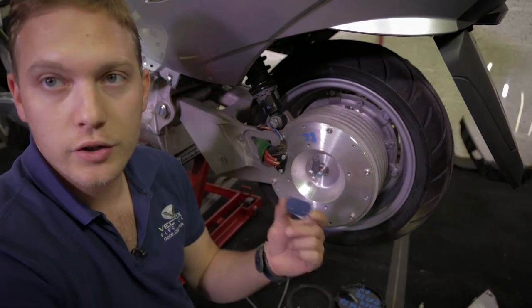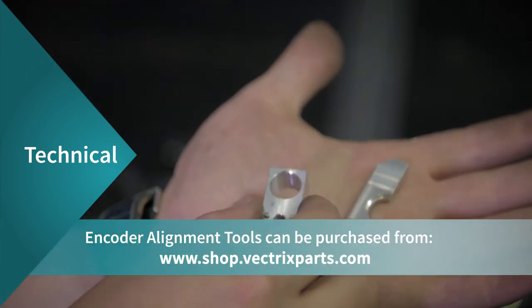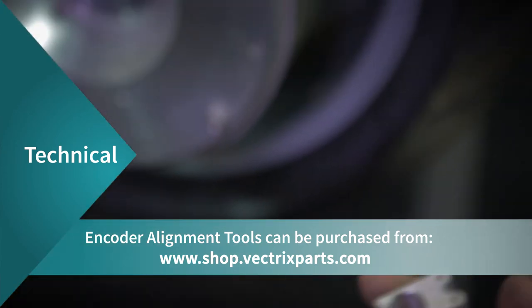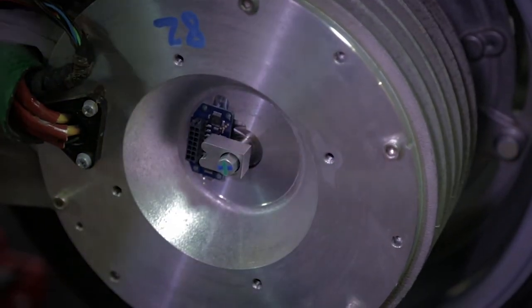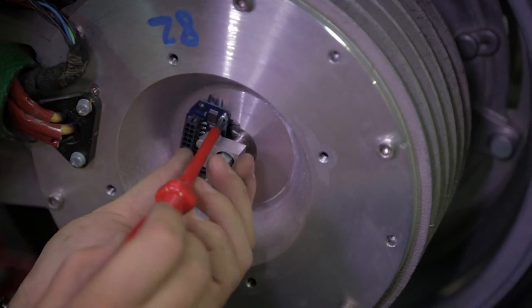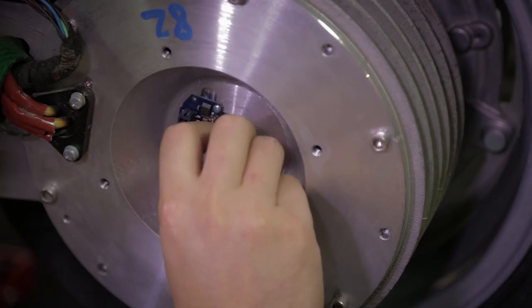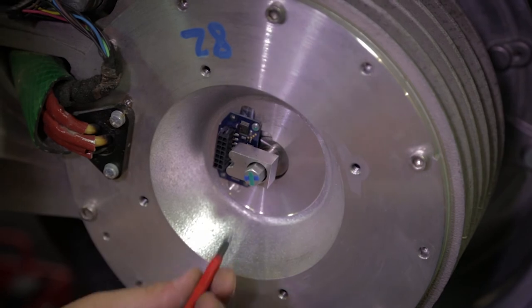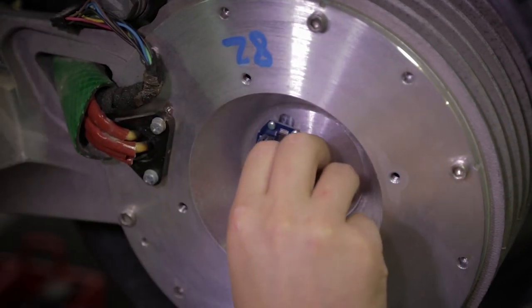Now, whether mounting back the original encoder or mounting a new unit, we need two special tools to define the position of the encoder and to align the laser to the lens. Take the first one — we can see there are two pins sticking out. They have to be inserted into those two holes here. Click them in. Then we can place the sensor and screw the sensor in position. The holes of the sensor are slightly bigger to allow a small free play, and then we lock it in the proper position. Then we can remove the first tool.